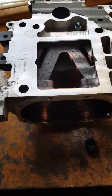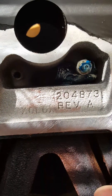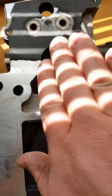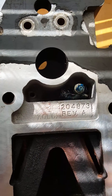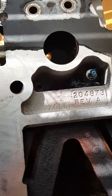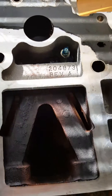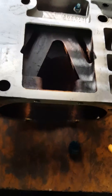Now on a fifth gen, back where you're going to see those needle bearings, you'll actually see the two humps where the bearings are going to be, but there are no holes drilled for them. So you can't do this method unless you want to take the chance and drill holes in the case, thread it, and try it — which I myself don't do.